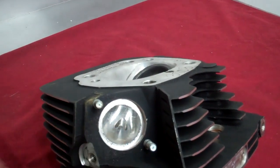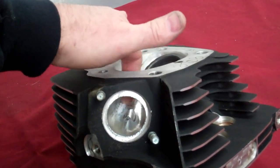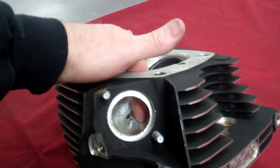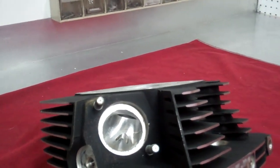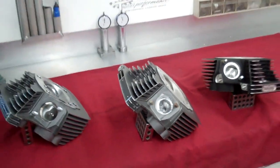We're also able to go in and repair the guide holes. The CVOs are very bad about having porosities on each side of the guide hole, and we're seeing a lot of hairline cracks on them. So while we're in there welding, we get all that porosity out, which works very well. What we're doing is making sure that we're giving our customers a consistent port time and time again.